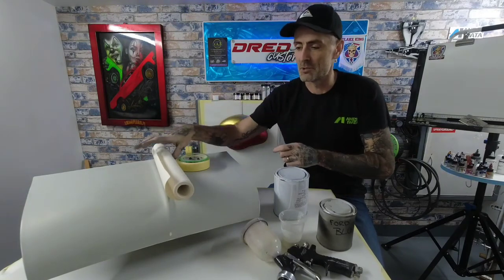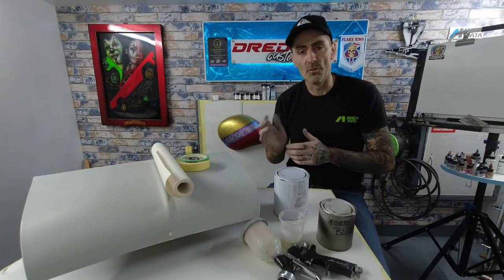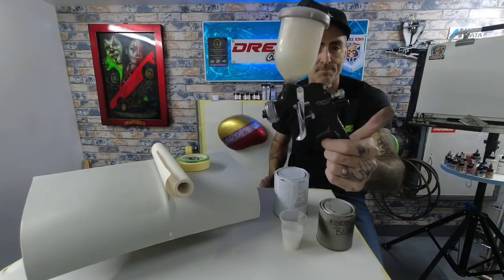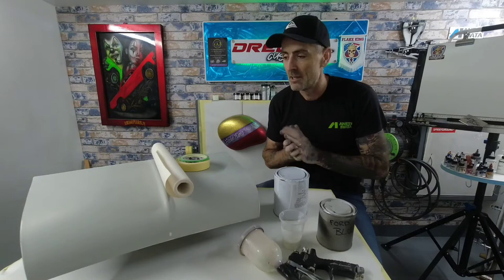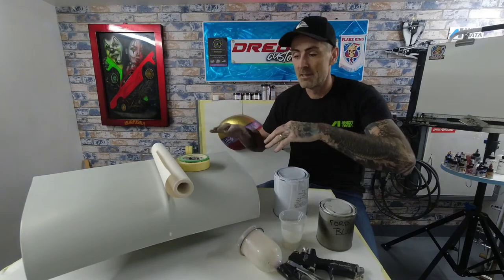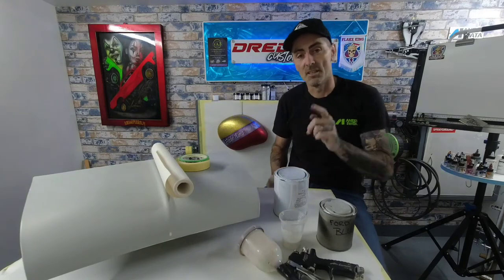So then the next stage is we've got fine line tape to do the bonnet stripes and masking, and we've got some paper so it can mask out the opposite side of the bonnet, but we don't need to get any overspray on. The gun that I'm going to use for doing this is the Iwata Impact Junior, little mini jet gun, so this will be perfect for this sort of size, great atomization. And it'd be perfect for dropping these base coats down. So I'll see you in the next step, and you'll just see me in the time lapse, be masking out, and you'll see these colours going in, and then I'll give you a talk through once I've completed that stage. See you in a bit.